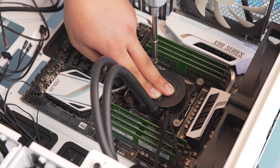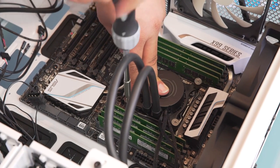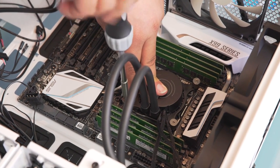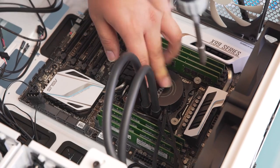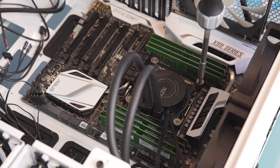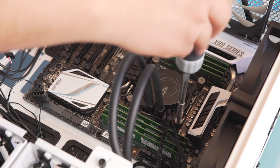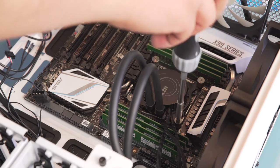We're going a little bit from everywhere with the screws, and the main thing is we don't want to over-torque this. With this platform — Socket 2011 — especially when there's no back plate, it's much harder to over-torque it. But the goal here is a solid finger-tight. It's not about how much you can crank each screw down, because we don't want to cause any pin-and-pad contact issues.